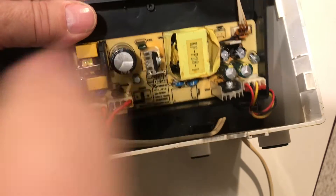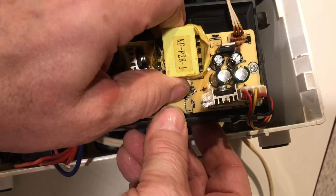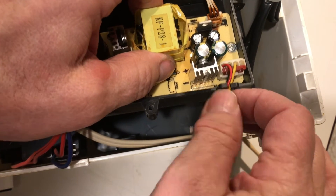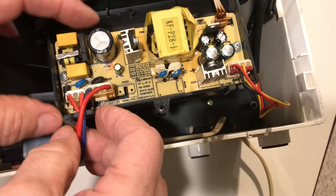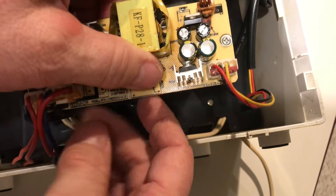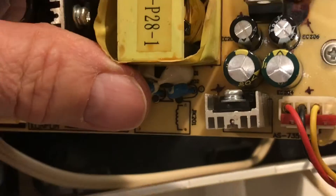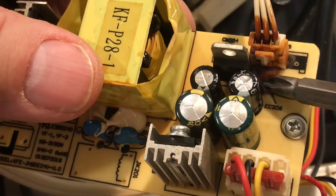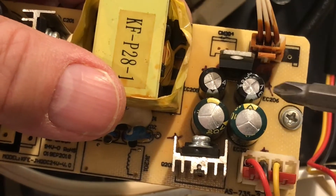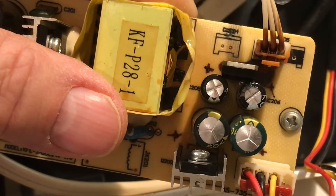Make sure we don't have any problems with electricity. Sometimes these capacitors can hold some juice, so you might want to let them sit for a long time before you get in there. Gently pull the wires aside — there's a little clip on either side that holds the wires in place — and once those wires are out of the way you can lift the circuit board up and out. You can see that there was a leak on one of those capacitors — that brown stuff all over the place. I've since replaced both of those capacitors, which are 470 microfarad 16 volt, but you can see the damage done from the one that had leaked.